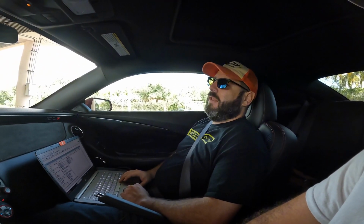This blower up top doesn't like to be spun that high and that hard, and you're not going to make power. This is okay. Raising the rev limiter too much more than that is dangerous and unnecessary. It's not needed. Yeah. Compared to my SS, it always fell short of the red line.